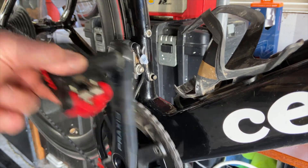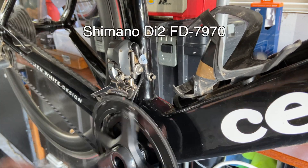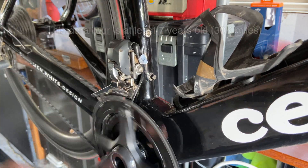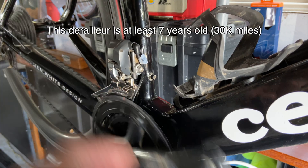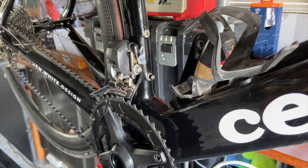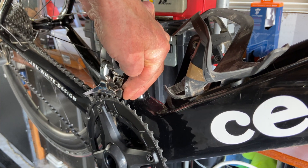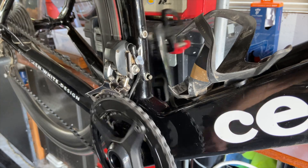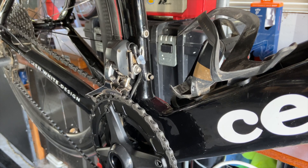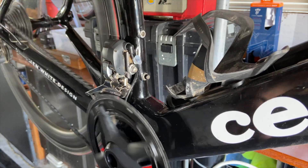Thanks for watching. This is Jim Langley. Listen and watch as I try to shift my old worn-out Shimano Di2 front derailleur — the brains of an electric shifting system. What's going on here is I'm pedaling with my left hand and reaching up over the handlebars, operating the front shift lever with my right hand. Now if I shift the lever, it tries to shift but it won't shift. I can push it, and it'll shift back down again, but you can't make it through the upshift.